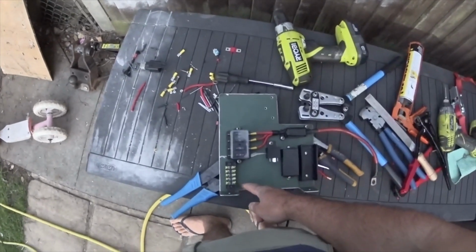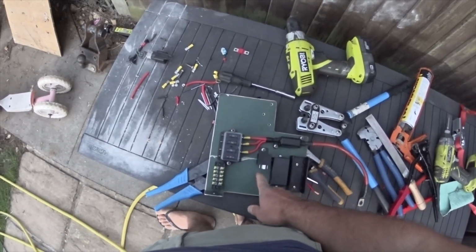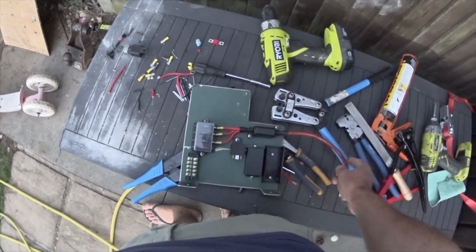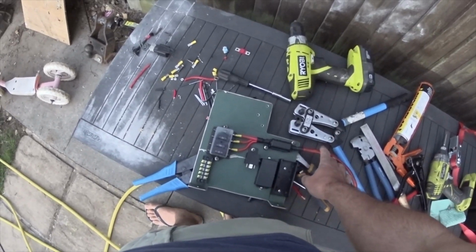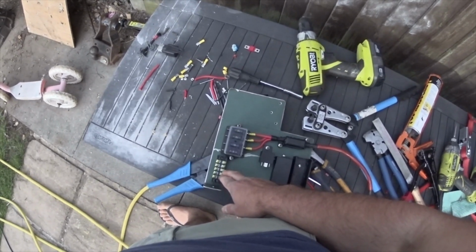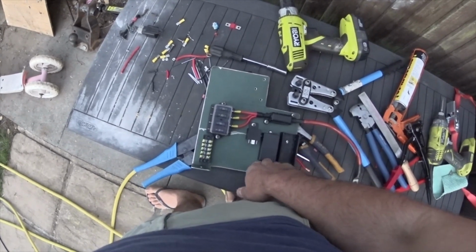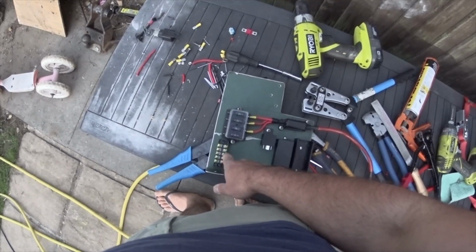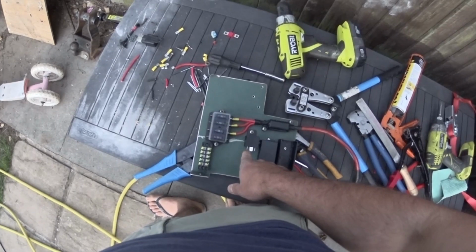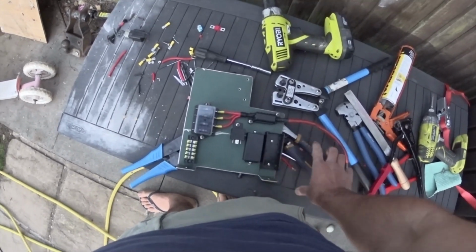Mr. Rabbit. Then we'll have a ground spur here, and that'll ground both of those, and that relay. That'll come around the back along with these, and I'll ground that behind the jack mounting. And then these three will be output, basically through output, so two of the outputs will come out here, and one will be a spare for that relay when it's wired up, and yeah, that'll go out to the contactor next to it.